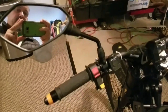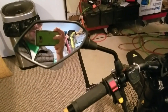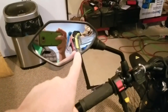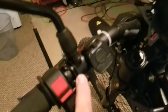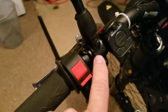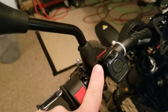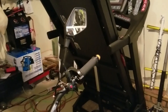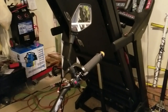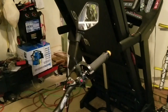Next I put mirrors on the bike. The fender was from eBay; everything else is from Amazon. The mirror kit came in two separate parts from Amazon: the mirror itself and the handlebar mounting assembly. The clamp attaches to the 7/8 handlebar and the mirror screws into the clamp — they come in a right-hand and left-hand kit. Mirrors are an absolute must if you're riding on the road or need to register the bike.